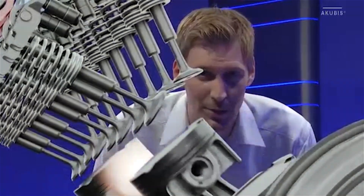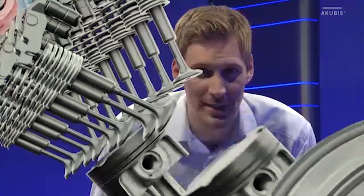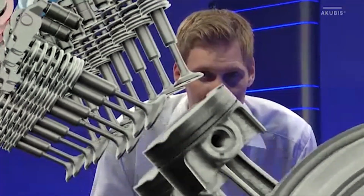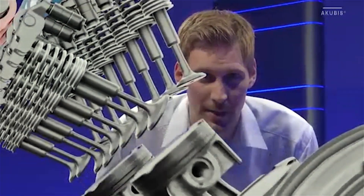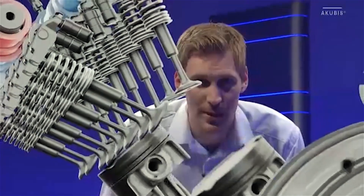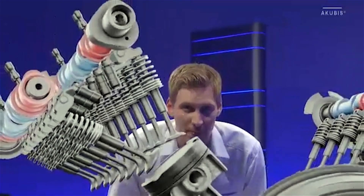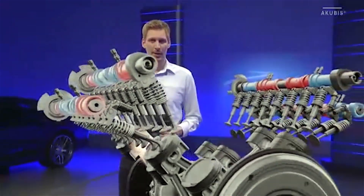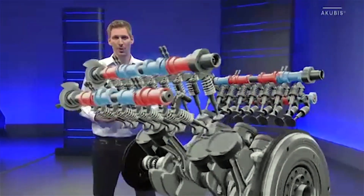When the cylinder is cut off, the valves on the outlet side are deactivated first. Subsequently, the injection and the ignition for the respective cylinder is overridden. Air is drawn through the inlet valve and the valves are also deactivated. The air in the cylinders prevents a vacuum from forming and oil from entering the combustion chamber via the piston rings.